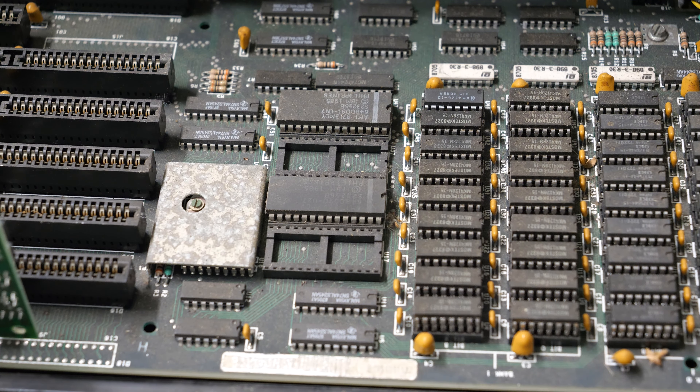Got a bent pin - that would have been a bad day. Let's see if the new BIOS will work. That looks good - Award BIOS software. Testing system memory looks good. Interrupts, protected mode, expansion memory - zero found. One of the reasons I wanted to try this Award BIOS, in addition to supporting the XT to IDE card, was that it comes with an escape sequence that allows you to program the BIOS settings without having to use a setup disk. And we've booted up into MS-DOS 5 installation, so everything's working OK so far.